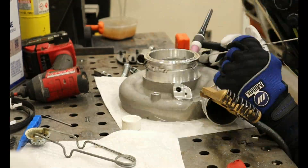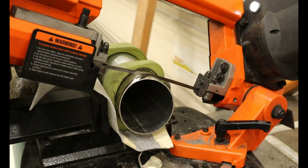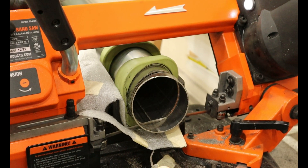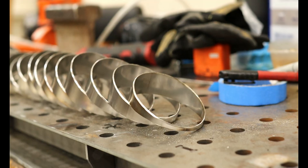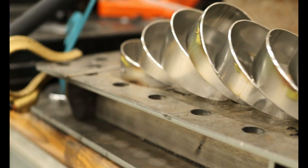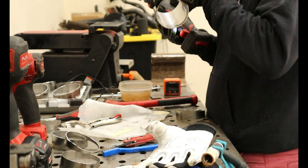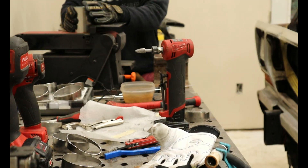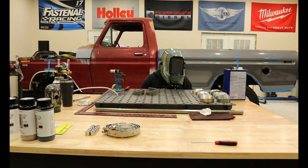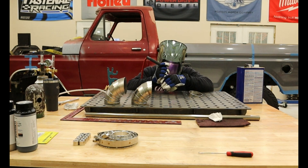I was ready to start making pie cuts. This is exactly where the project took a turn for the worse. I got the exhaust into the bandsaw, ready to cut each slice. However, my bandsaw blade barely touched the stainless and eventually the blade broke on me. I eventually cut all 18 pieces for each of the four 90 degree bends. I cleaned them up with a carbide bit and used the belt sander to sand them flat where I was then ready to tack them together. As soon as I started, I found each piece was a little bit different size, possibly the saw squishing them as I cut through.